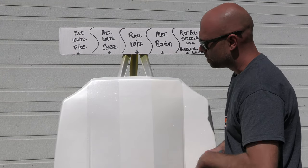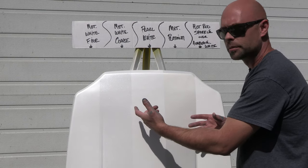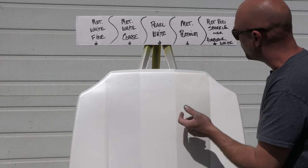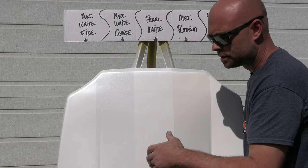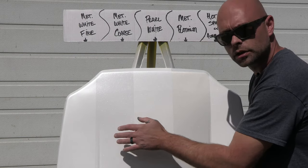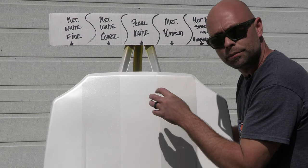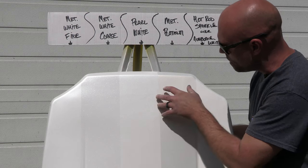We're outside now with the panel cleared on a beautiful sunny day so you can really see the difference in the metallics. The two metallics — the fine and the coarse — are very bright, clean whites; it's just a one-dimensional color shift and a bright nice ground coat for doing graphics. When you step to the pearl, you can see it's a little yellower in terms of brightness and cleanliness, and there's a little bit of green, blue, and red color shift — that prismatic pearl effect. The platinum is a little bit darker than the pearl but it also has that prismatic effect.